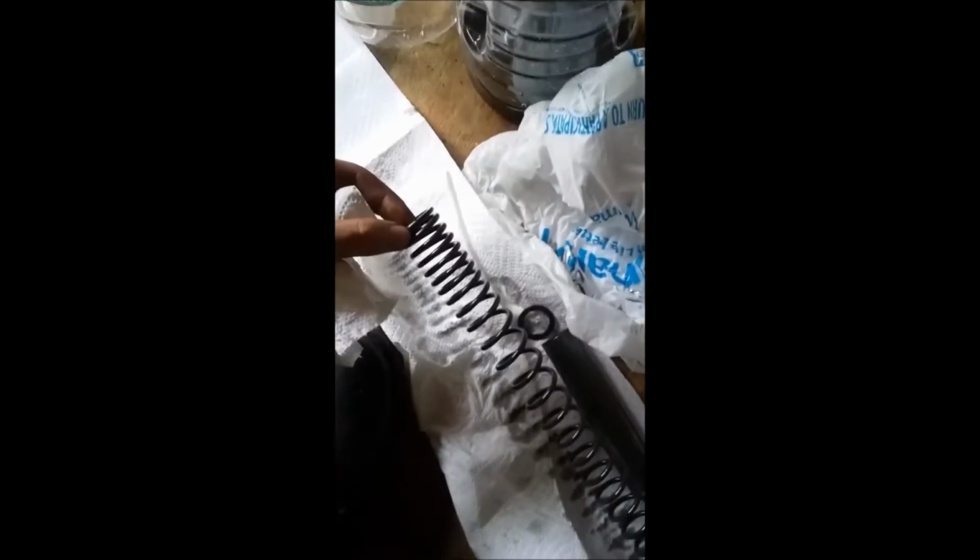When you tip your fork upside down to drain the oil, your first piece, I mean, some of these cartridges are all bolted together. On this one, they're free float. You got your top here. That comes out of the top. Below that is this washer. Just be careful because on some of them, they have a washer at the top. Then your spring assembly. Remember which way it comes out. You see it's a little bit thinner here at the top, not at the bottom. This is your top right here on this one at least. Somehow they are like that on both ends. Maybe they're interchangeable. This spring is not.